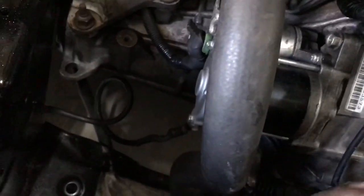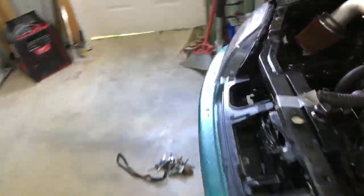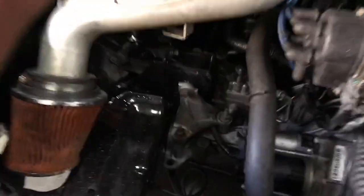I filled up the reservoir. The first thing that's gonna happen is the clutch pedal is gonna fall straight to the floor because there's no fluid in there, so use your hand to bring it back and forth. Do that a couple times, then go check your reservoir. Make sure you've already cracked your nipple open so the fluid has somewhere to go. Continue to pump the pedal. I've been continually pumping and filling the reservoir — it took me three sessions of pumping and three fills before I started feeling more resistance.